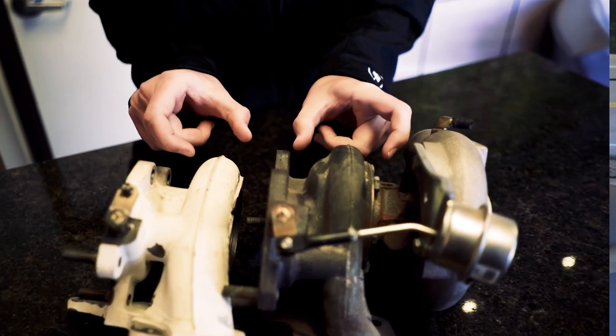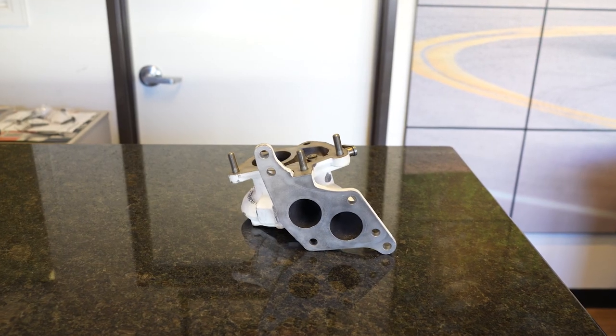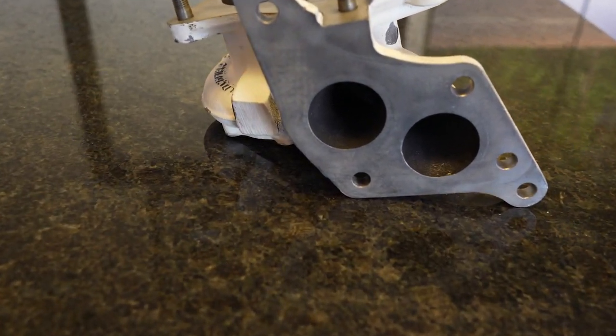For the smaller displacement engine they had smaller hot-side twin scroll turbos to get the turbo to spool more quickly, versus something like the Block turbos which have full twin volutes all the way around a very large exhaust housing. The Turbo Dynamics LM450 only keeps the exhaust pulses separate until they enter the exhaust housing, then it basically converts back to a single scroll turbo. The LM450 and the DOM 1.5 are roughly the same size — both in the Garrett GTX30R family — but the LM450 spooled up significantly faster. We actually went from the LM450 to the DOM 1.5 and back again, and the DOM 1.5 gave us similar numbers but spooled about 500 RPMs later.